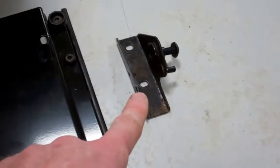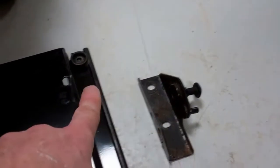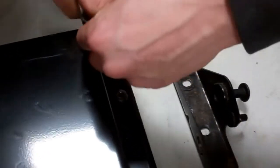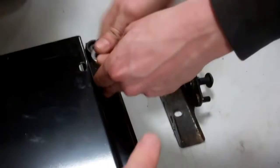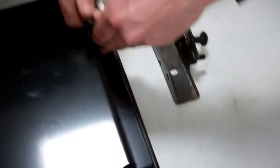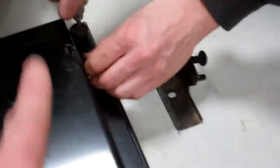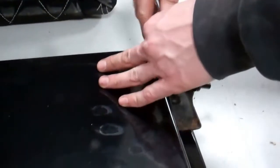Although we've built all this subframe up, if you're going to use the seatbelt pretensioner you'll need to fit this bracket that we took off earlier in the video. We're just going to do that quickly — whip those two bolts out at the back. Obviously we should have done that in the correct order, but if you're putting in a harness seatbelt you can choose to fit it or not. We'll undo those and bolt that in — there we go, got those lined up and bolted on.